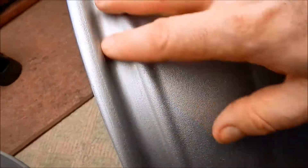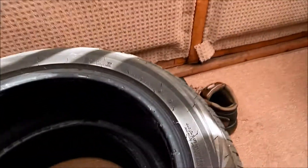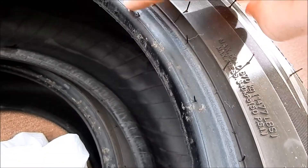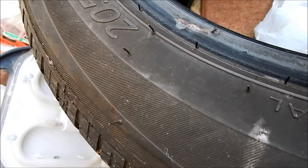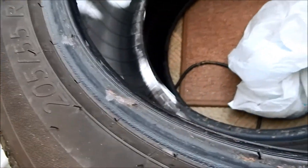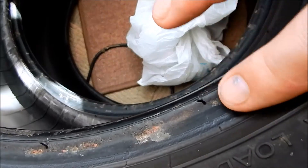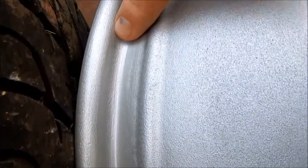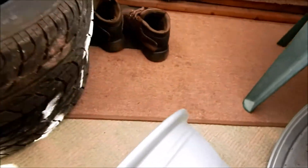That's it — that's what you've got to do. Once it's smooth and shiny, I'll take it back to the tyre shop and he'll put the tyres back on. It's the lumpy bumpiness of the corroded rim that causes the leak. You can see there are some little marks here where the corrosion has kind of attached to the rubber. It's this bit here where the seal forms that notches into the concave bit on the wheel. I look like I've been trying to apply silver nail varnish, but I promise you I haven't.